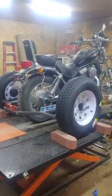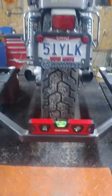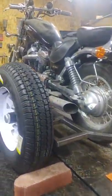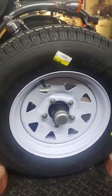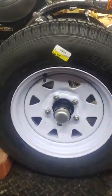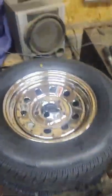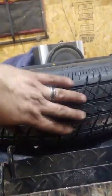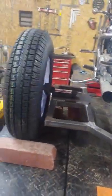Here it is with the tires on. She's level — I leveled the bike and this is what it's going to look like. They wanted cheap rims and tires so they bought their own from Royal King at $99.99, so about $200 worth of tires. They're not as good — they're rounded like cheap trailer tires and thin. The ones we supply are wider, flat, and have more contact with the ground. These customer-supplied tires are not balanced so I would get them balanced.